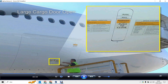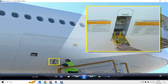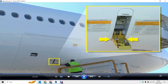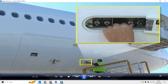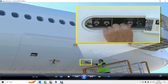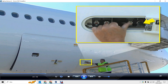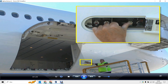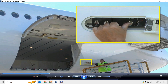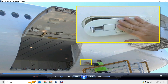To open the large cargo door, push the catch release in and pull the lock handle fully open. Make sure 'unlock' shows on each side of the handle. Open the panel and make sure the area is clear. Hold the control switch to open and make sure the green door latch light goes from on to off.